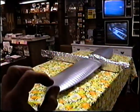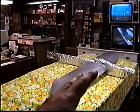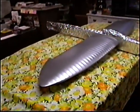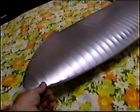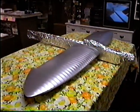By the way, the amount of silver that's on here now is almost negligible, because the amount we've saved by not having a blocker coat underneath, we would need more pigmented paint on top. So in essence, the whole finish is not going to be any heavier than if we had no silver on at all. And I've proven that many times. The silver actually saves your weight by not having to go back with so much pigmented paint later on.